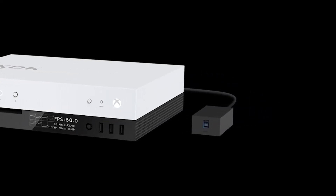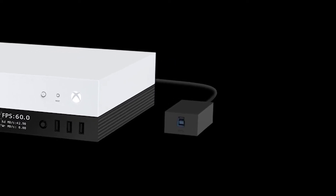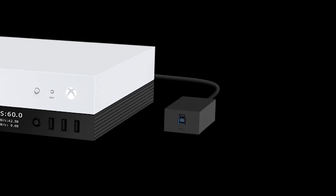I also noticed there's an additional piece of hardware hanging off the back here. What is that for? That's what we call the Xbox transfer device. One of the pieces of feedback we heard from our partners was that iteration times are super important, and part of that is deploying your build from a PC to the console. The Xbox transfer device facilitates speeds up to 450 megabytes a second, so a deployment can happen in less than four minutes, where traditionally without it a full build could take up to 20 minutes.